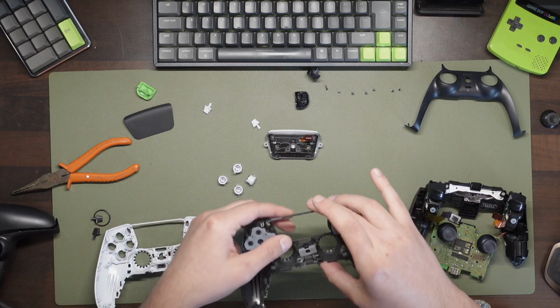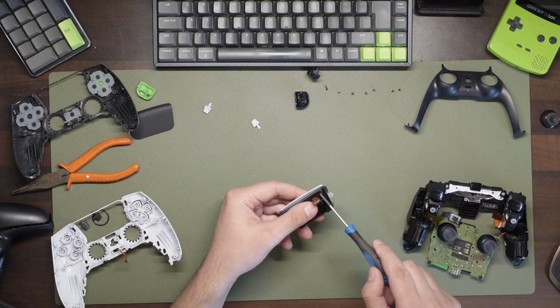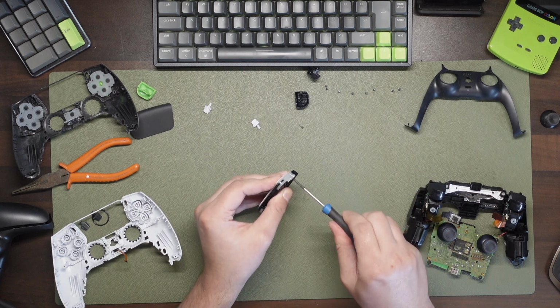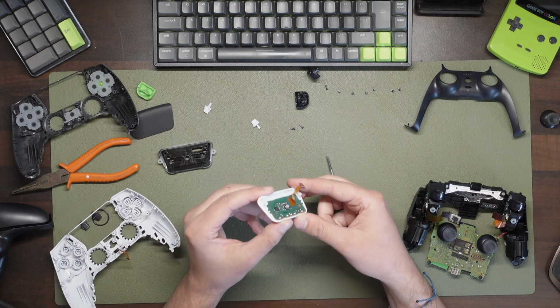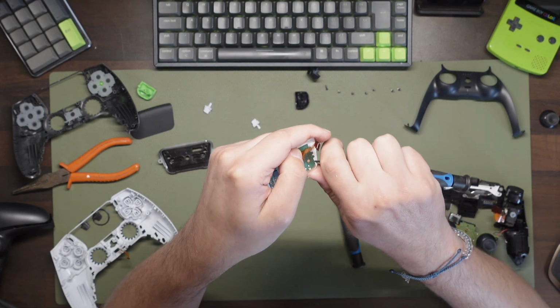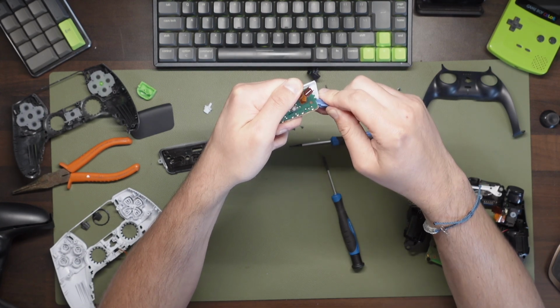Now for the tricky bit that simply requires a bit of patience, but I can confirm that this particular part was designed by the Dark Lord himself. Unscrew the final screws on the touchpad to remove the black mount. This reveals that the board has actually been glued to the white front. Using your pry tool or something similar, start to cut away at the glue around the edge until you can pry it off. Take your time with this not to bend or damage the board.